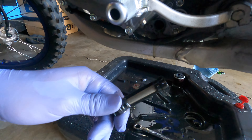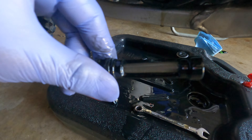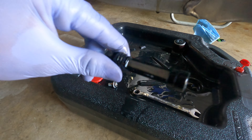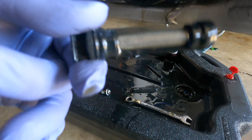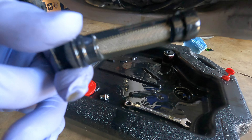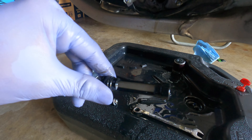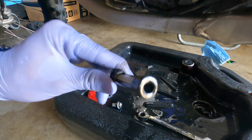This is a screen that you will be needing to clean out sometimes — maybe a little trash in there. This is my third oil change. The first oil change I had a little bit of metal shavings, but that's regular because it's a brand new bike. You just clean this out, blow it out with the compressor or something.